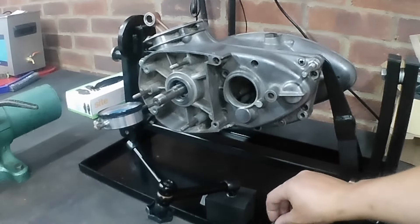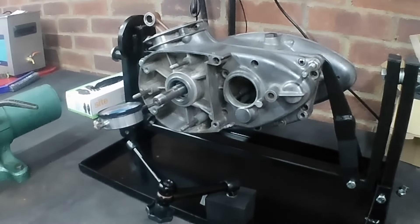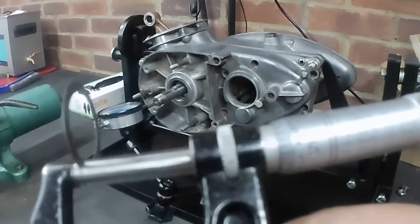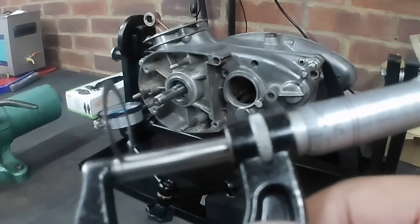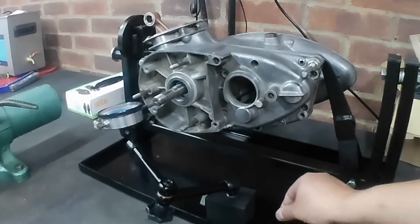What I do have is a couple of sevens. So I'm going to fit a seven, and that should put us at five — right in between the tolerances, right where we need to be. Four to six thousandths and we're going to aim for five. Hopefully you can see that's a seven — that's what we're going to fit and that will be just fine and dandy, right between the tolerances.